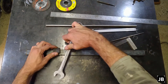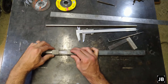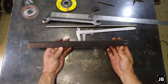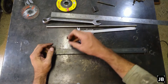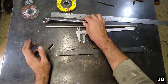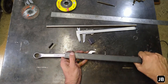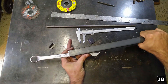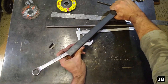Something in that order so that your wrench can fit in there. I'm going to quickly cut it off — I won't show it on the video, we all know what it looks like when you're grinding. Okay, so we've got the handle cut, a little hole in the end — maybe we'll hang it up somewhere sometime. Next up we have to weld on these little pieces of angle iron. Now you must think a bit about it: what are you going to do? You're going to use this to loosen nuts, so you're going to go in an anti-clockwise direction. So we need them on these two edges so that we can actually hook it in and then loosen it.